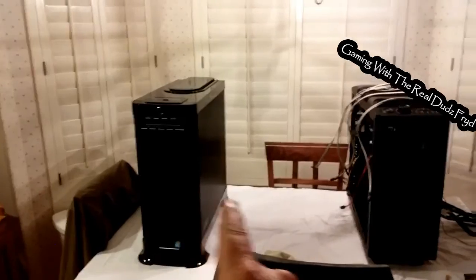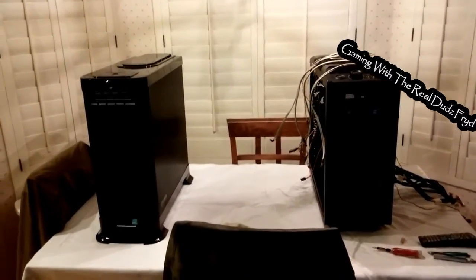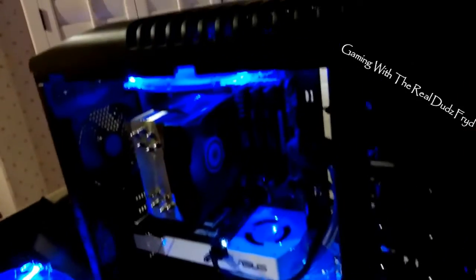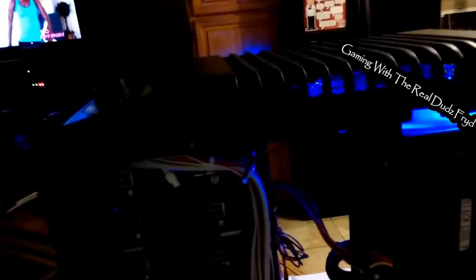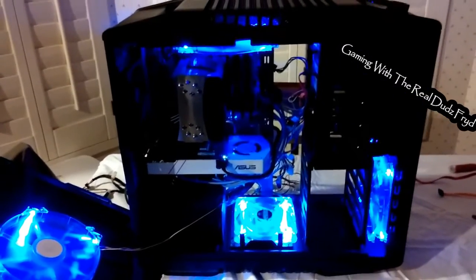Good perspective of where we're going here — that's where we are, and that's where we're going. So hopefully we can make this Xeon run a little cooler. Here's some progress: we've got it pretty much re-cased. Everything's in there, the 970 is in there, the fans seem to be working. Still got a little cable management to do on this side — a little messy, but we'll clean that up. We'll see if we get our temps down at all. The big question was would the side case panel fit — yes, there is clearance. So we can keep that fan and keep exhausting the hot air out.